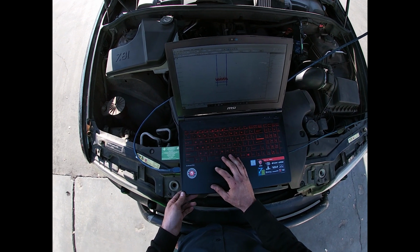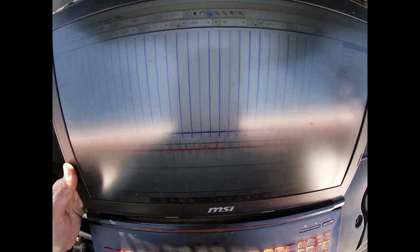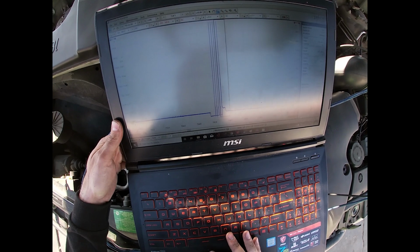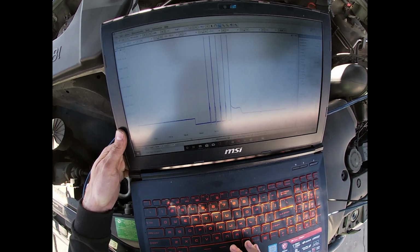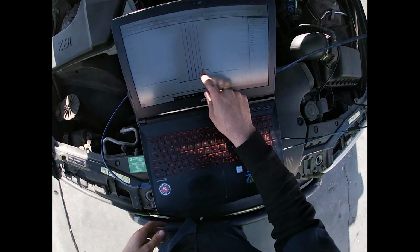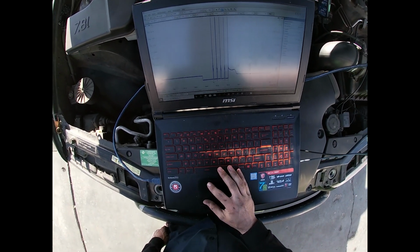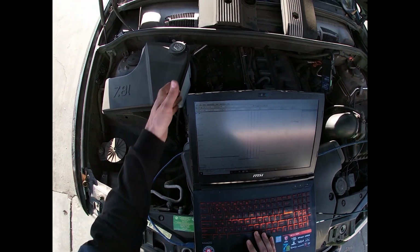So I just hit start recording. Zoom in on one of them. And that looks like that one coil on the Kia that I just did, where it doesn't look nice. It's just short, abrupt, and it looks weird on the spark line. But I'm missing part of the picture here, and I want current ramp.